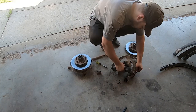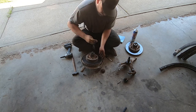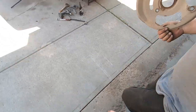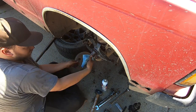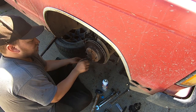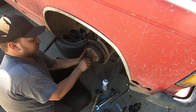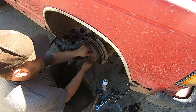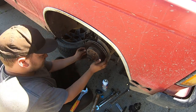Those seals are well enough intact. Someone actually did these wheel bearings properly. Get rid of this shipping grease. In a perfect world I'd probably grease these bearings too but I just really don't have the time or care. Everyone does their wheel bearings setup a little different — I like to get it by hand, give it a good quarter turn just to get some seating action in there, back it off, little finger tight, and then the closest notch.